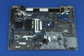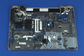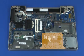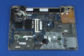Before installing a new top cover, remove the following from the old top cover and install on the new top cover: system board, optical drive connector board, speakers, function button board, power button board, fingerprint reader board, touchpad board, smart card reader board, and USB board.